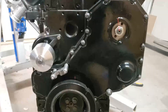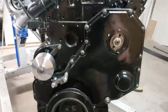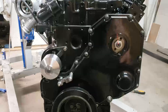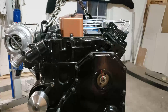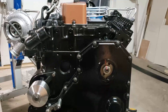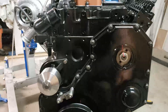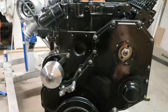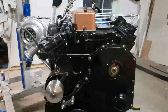So just a quick reference — I know that's kind of a long-winded explanation, but I wanted to show you what I did. I'll include some pictures of the pins I've snapped because I have a collection of them now. Hopefully you don't have to make the same mistake I did. You can find the pin hole in the camshaft, make a couple marks on the crank and on your injection pump, and always have a quick reference for where your motor is at any given moment. Hope that helps. Take care.